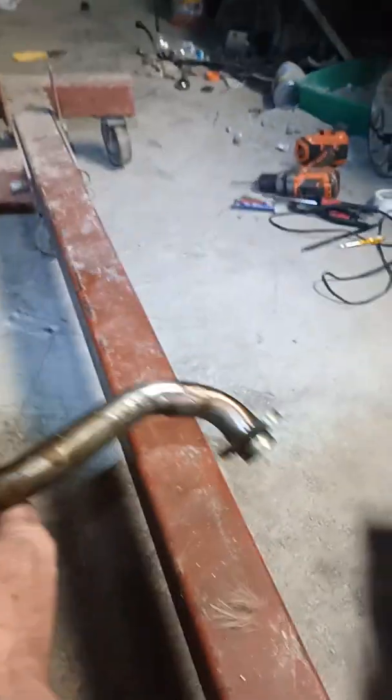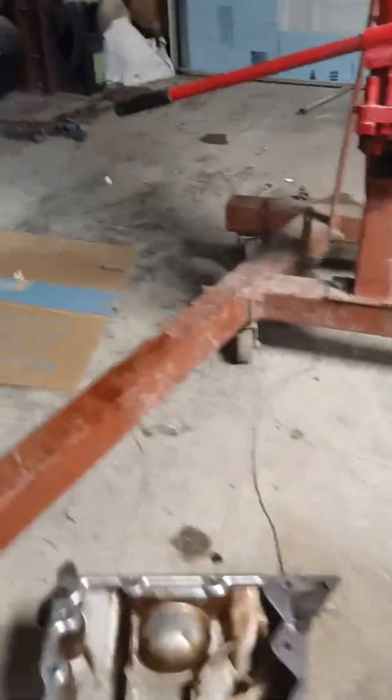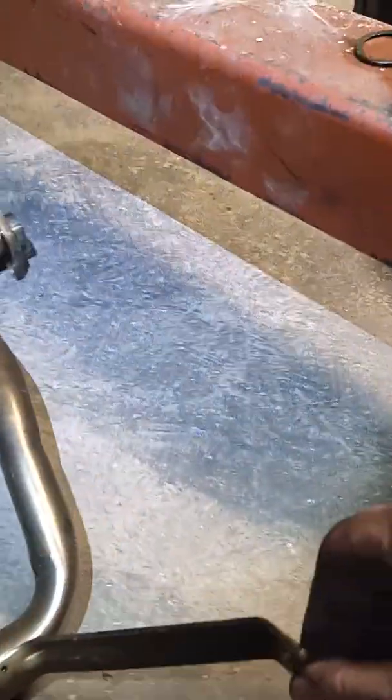All these oil drains are in the same spot. This is the pickup tube for the Mustang, and this is the pickup tube for the front wheel drive. Now, I did forget one thing — this baffle right here for the oil has a hole in the back for where it bolts. When I got the oil pan today, I needed to get the oil baffle for the front wheel drive and I didn't do that. So it's not going to have a mount — right now it's only got the bolts in and it's not tight.